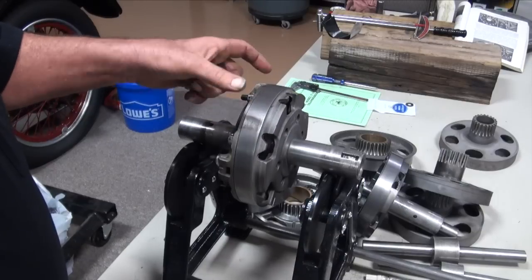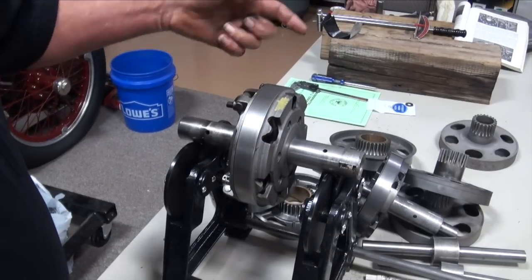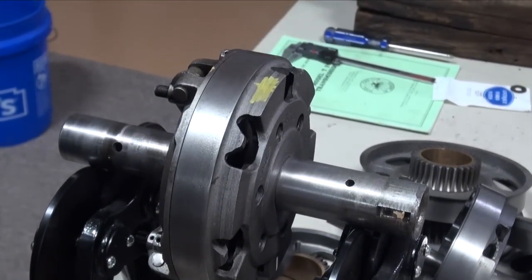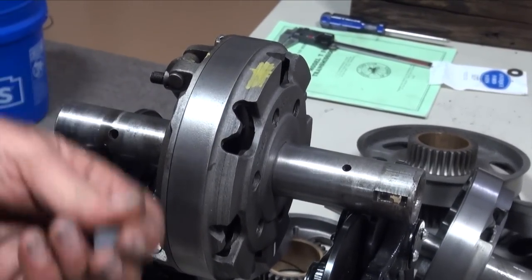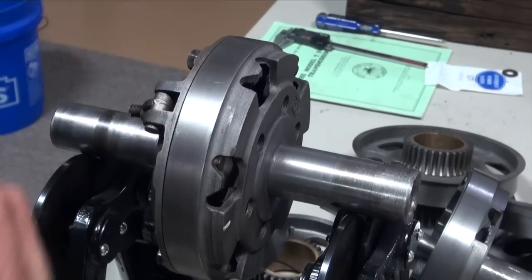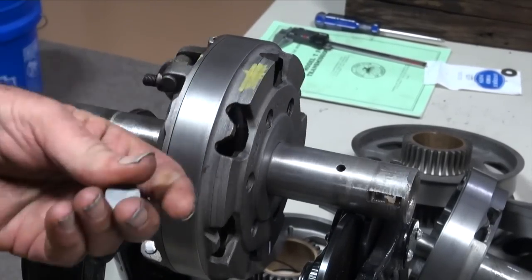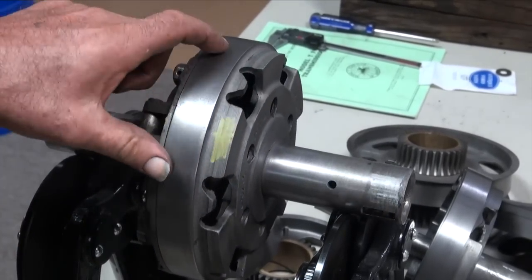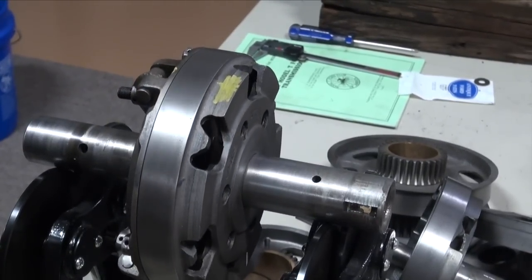For the brake drum and drive plate, generally it's removing material — never adding. For the reverse drum and low speed drum, generally I'm adding material because they're thin. There's not a lot of material to remove, and so if you get one that drops like a rock, you're better off to add material to it. That's usually done with a nut and a bolt, drilling a hole through the web in an area where it wouldn't cause a crack.